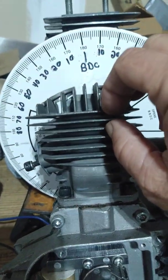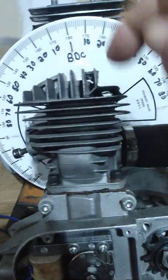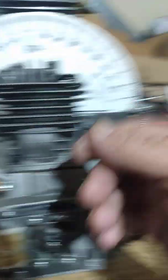With a big gap above the piston, using your calipers is just trying to induce a lot of error. When you've got a big gap like that, the best thing to use is a piece of Play-Doh on top of your piston — torque your cylinder down, roll it up to TDC, and squish it, then roughly measure that.